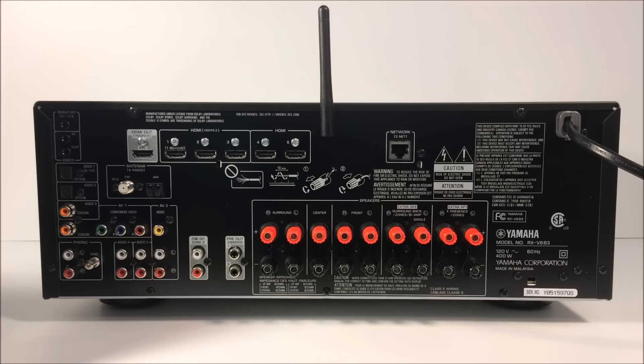We decided to take a look at the back panel first. We're not going to go over every single connection point, just the main points. This unit has quite a number of HDMI inputs. It does process a 4K television signal, and we'll describe those in a bit greater detail because some viewers will have questions about that. The HDMI does support ARC, which is the audio return channel. By connecting an ARC-compatible television to this receiver, it'll send both the video and audio signal over one HDMI connection.